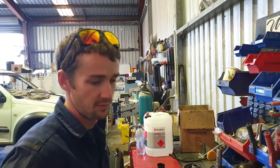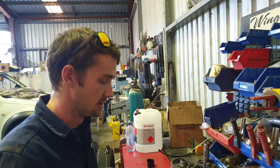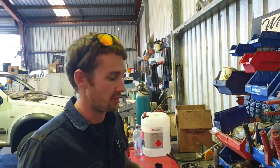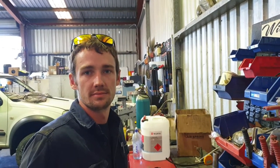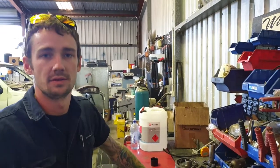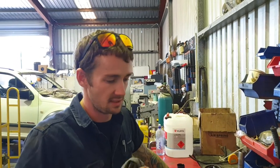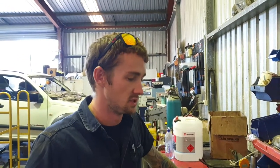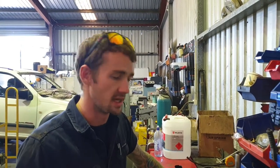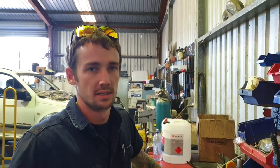And that's why we continue to service and monitor them every meeting — because that would have been either caught or prevented by servicing. So that's just a quick rundown of using the things you've got in your own shed. Nearly everyone's got a grinder. You might not have a press, but wrap it in a rag and two bits of wood and put it under your car tyre, or even a 20-kilo oil drum — sit on there for half an hour and let it ooze out. But if you're doing the stuff like we're doing, giving it hell every single meeting, you'd be silly not to be doing this. You've really got to keep on to it because the oiling is the biggest part of your motor.